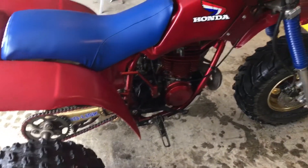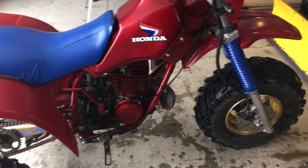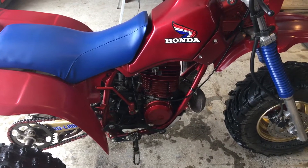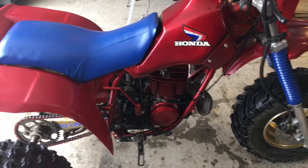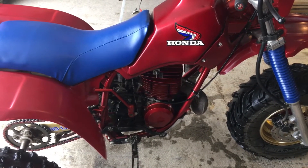It's an aftermarket seat cover — the closest I could get. Tank done, fenders, sprockets, chains. No welds on this machine — zero welds, which is very hard to find. No welds on the frame, no rust. We did sandblasting and cleaning up. On the engine — where do we start? Built right from the crank. The base was split, all the gears were inspected, synchronizers, clutch.